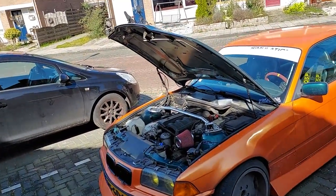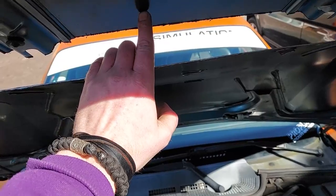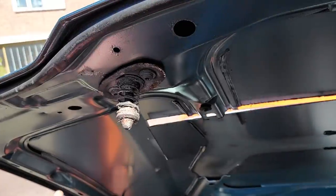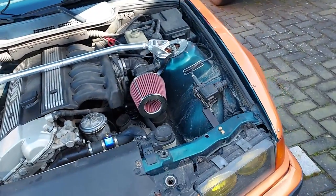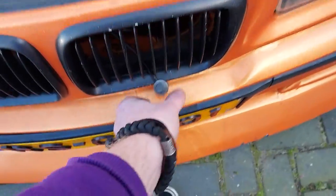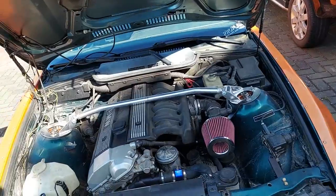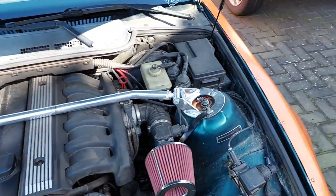So we got the old support off and put the other hood on, and now we're gonna see how far we can pull this down and what the gap looks like. We're also gonna take the latches off because I'm going with hood pins anyway. If the hood isn't fully aligned, it can get stuck in the latches with a lot of sideways pressure, and the release mechanism is hard to deal with. So we'll take them off and just put it closed.